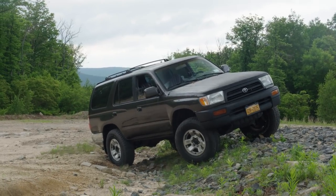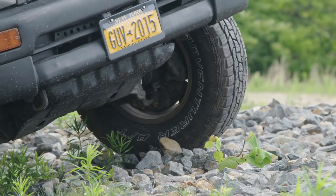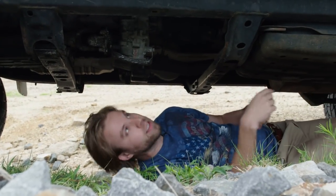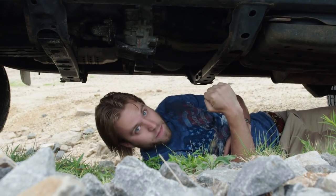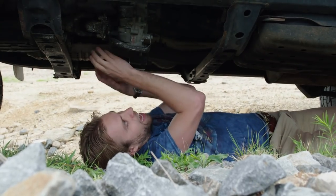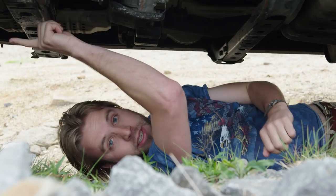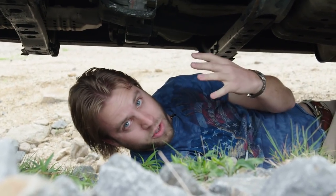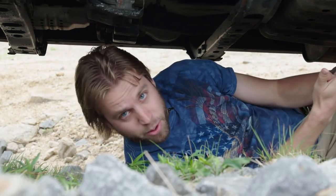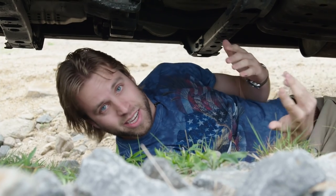We've parked up on a little bit of a crag to give us the Bush Mechanic lift. Normally when you're driving a truck like this it's going to be rear-wheel drive — engine comes down, spins the driveshaft, spins the wheels. When you throw that lever and drop it down to 4x4, the transfer case comes into play, adding an extra gear so power moves up and spins the front wheels. Boom, four-wheel drive. Now we're going to walk around the parking lot, see what the other boys brought, and talk to Kyle, our expert off-roader around these parts.